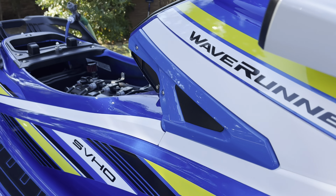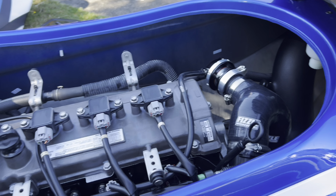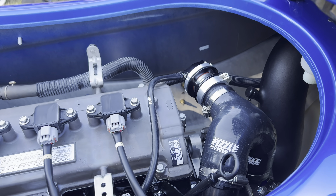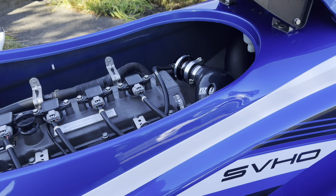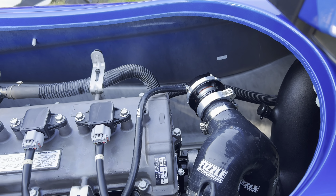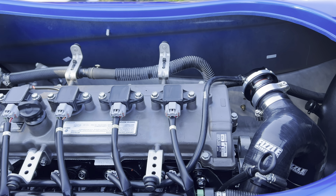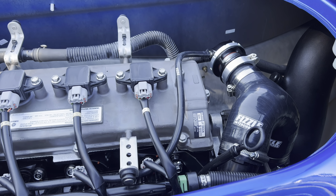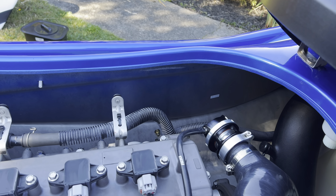It's the next day now. Something I forgot to mention: while you're doing the supercharger clutch on these things, because you're taking the front half of the motor off, you're going to need to drain the oil. That's something I did after I got the oil pump off and didn't realize I forgot to evacuate the oil out of there. So that's something you probably want to do before you start this project. The supercharger — I put it back together last night, got everything all together and cleaned up. I'm going to give it a quick start and you can hear what it sounds like with the new supercharger.